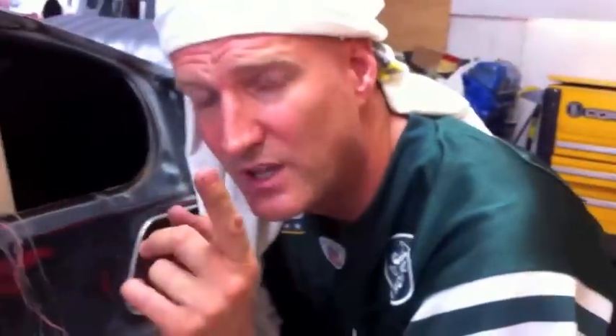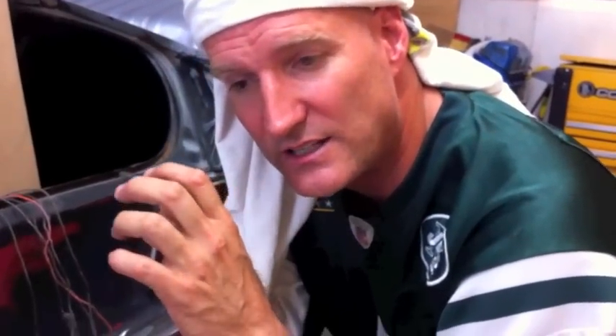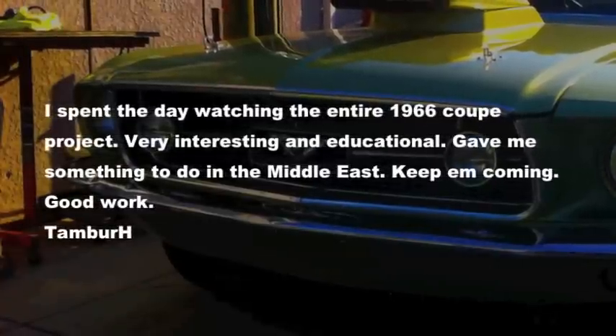Also, a viewer noted that the reason the headlights are going down is because with the headlights on there's not enough power. We're going to test it with the engine running. I've got some really high-intensity light bulbs in there pulling too much amperage and I think that's why they're shutting down and coming back on - so I think we've got that problem identified too. Thanks for watching MustangMedic.